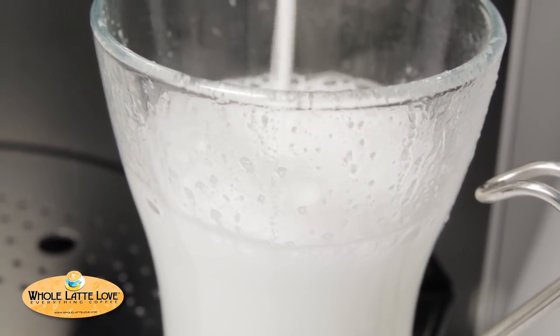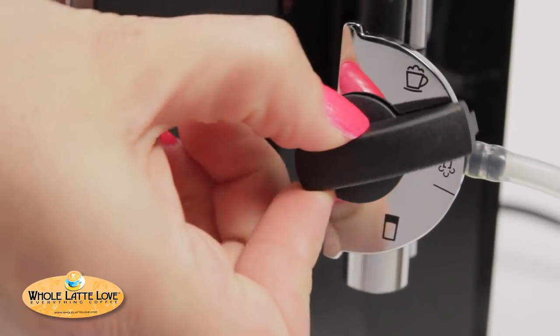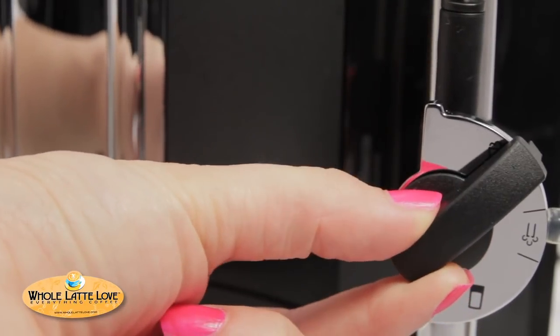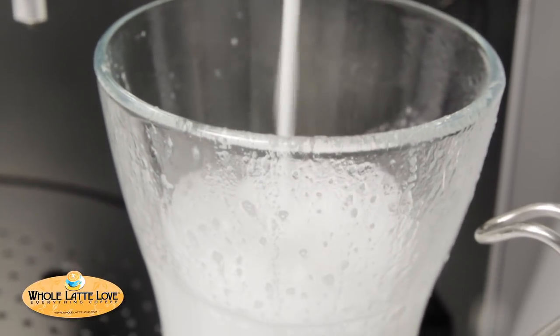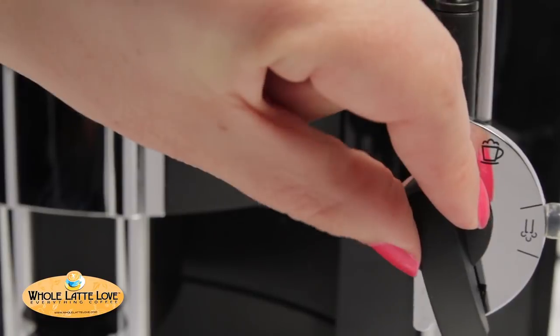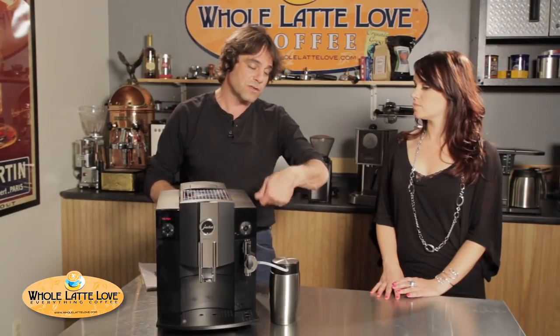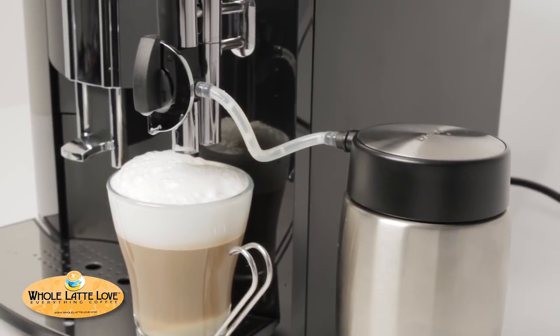I know you took a good long look at this — tell us some more of the features. On some machines you can't really vary the quality of the froth or control the temperature, but on this you can. The center position is steam, and if you're doing froth, as you turn the dial closer to the steam position, you'll get a hotter and airier froth. We found that if you're full up at 12 o'clock in the froth position, the milk comes out at about 109 degrees; as you go closer to steam, you can get that milk up to 170 degrees. The same holds true on the bottom side for steamed milk — in the full steam milk position you get about 106 degrees, and closer to the steam position you'll get about 130 degrees. The milk container comes with three lengths of hosing, and just so everybody knows, this is not dishwasher safe.